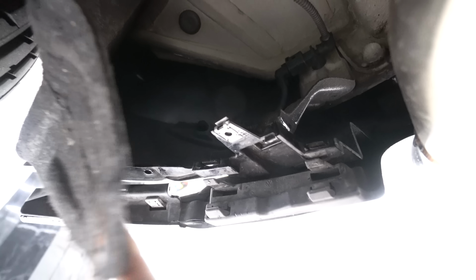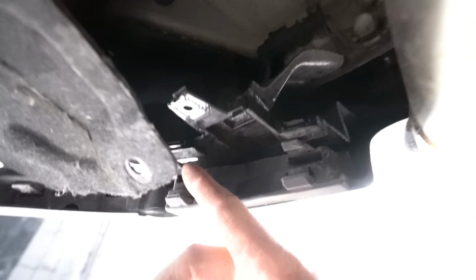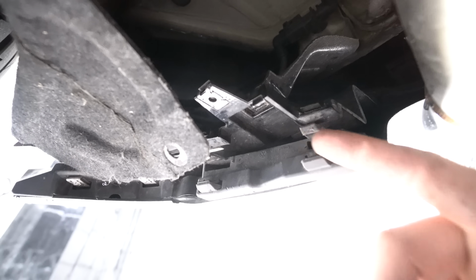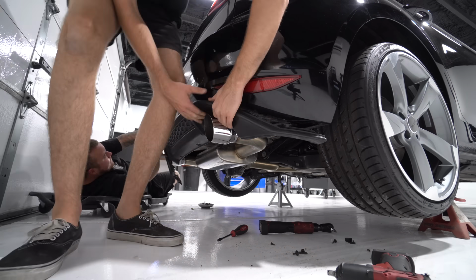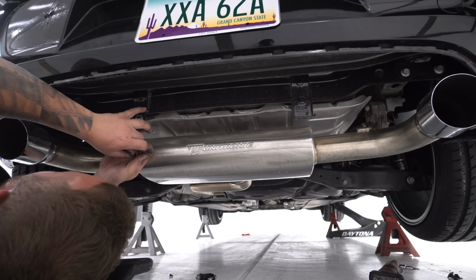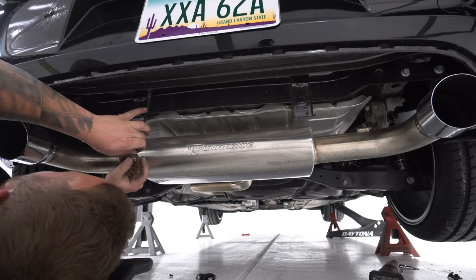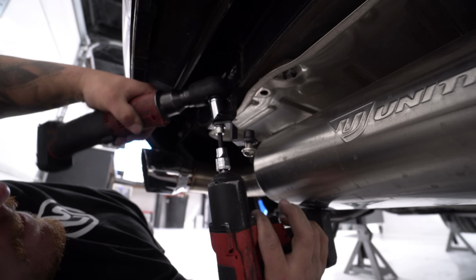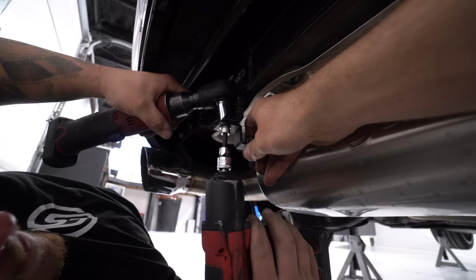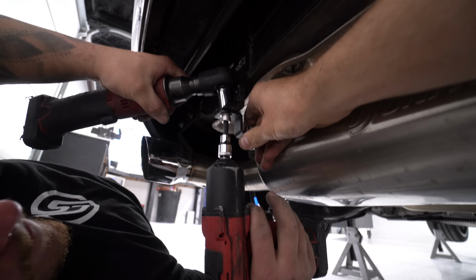Before you pull the bumper off, you want to get this tab right here and this one right here out of that piece above it. You'll see when you get to doing it. Don't let these brackets intimidate you either. Just pay attention to how we put them in, look at the PDF directions, and you'll get it right.